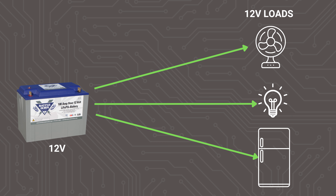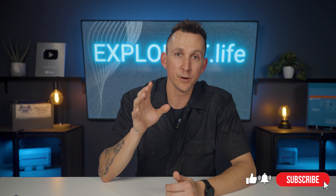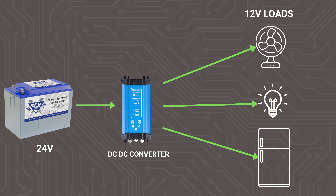How do we power 12-volt loads? In vehicles like vans, motorhomes, RVs, or boats, there are numerous 12-volt loads such as lights, fans, and refrigerators. If you have a 12-volt battery bank, no additional devices are needed to convert power for these loads. Most 12-volt appliances operate within a voltage range, so powering them directly from a 12-volt battery bank is typically not a problem. However, if your system includes 12-volt loads but uses a 24-volt or 48-volt battery bank, a DC-to-DC converter is necessary. What is a DC-to-DC converter? A DC-to-DC converter adjusts one DC voltage level to another. For example, in a system with 12-volt loads and a 24-volt or 48-volt battery bank, a DC-to-DC converter would step down that voltage to the 12 volts needed for the appliances.